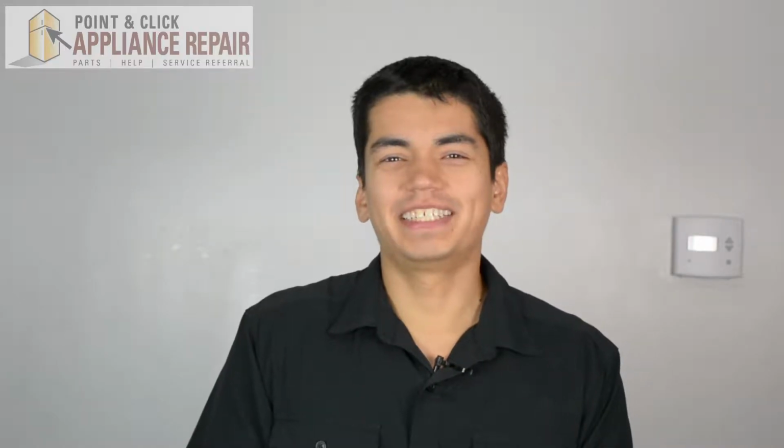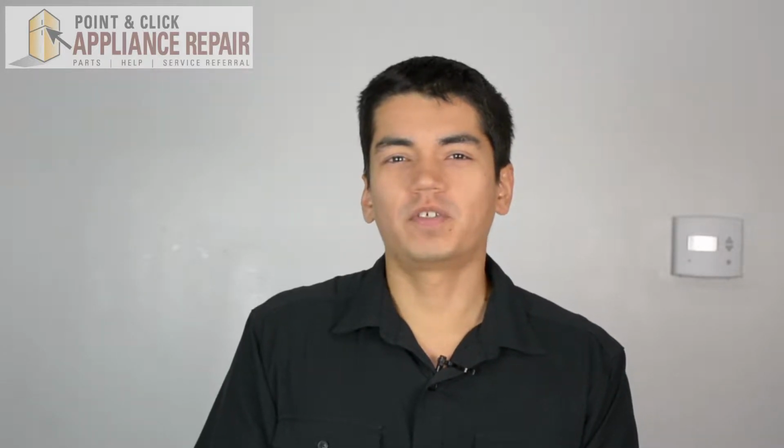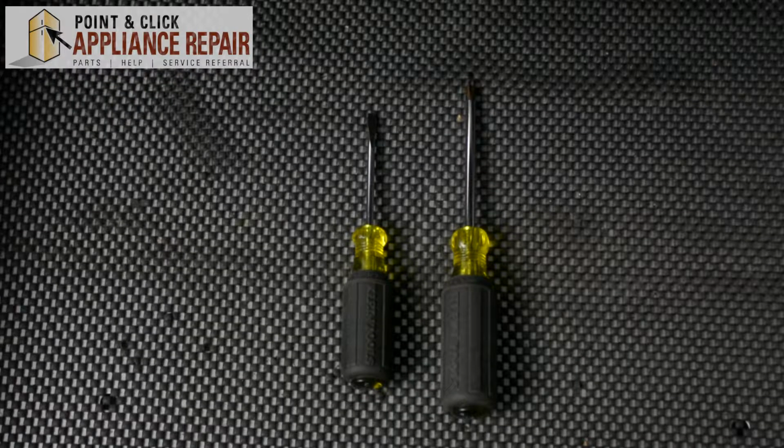Hi, my name is Bill, and today I'm going to be showing you how to replace the blower housing lock in your dryer. The reason why we would have to do this is because it's damaged, missing, or broken. For this repair, we'll be using a flathead screwdriver and a Phillips head screwdriver.